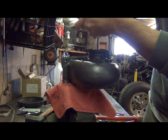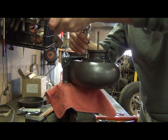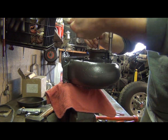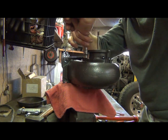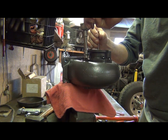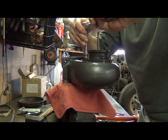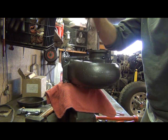It's spinning — I can hear it rubbing a little bit, but once we seat it down flat it should be good. You just keep going back and forth. You want to make sure this seats down there flat because there's not much clearance in there, and you don't want that fan blade and wheel to rub — that's not a good thing. I've got those pretty tight now.